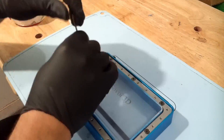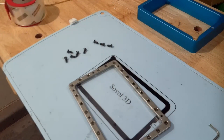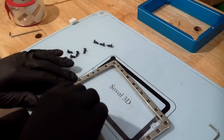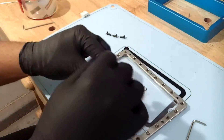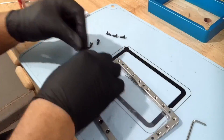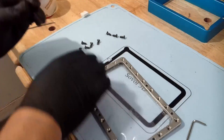All jokes aside, once I got all my ribbon cables and connections back on the board, I pushed everything back into the printer, secured the four screws, tightened it up, hit power, hit exposure — everything worked A-OK. Now there was resin on my old screen, but since this is a new screen, to avoid getting resin on it again, I went ahead and changed out the FEP sheet on my printer. It's a simple process but takes a little time, especially wearing gloves with resin in the nooks and crannies of the vat.